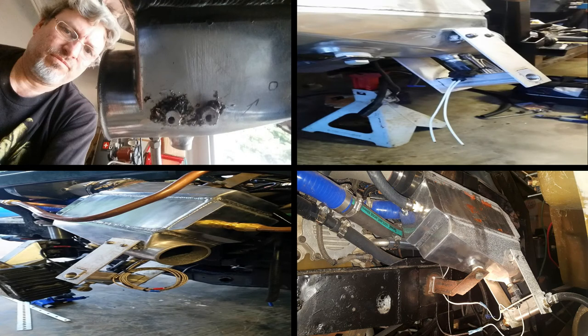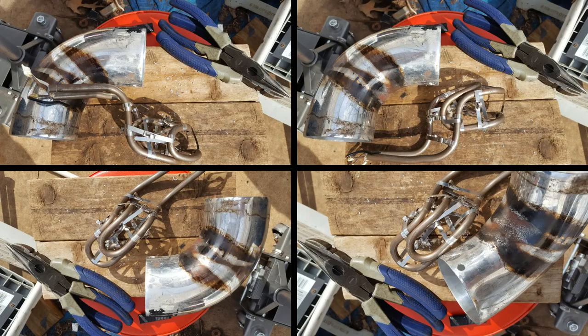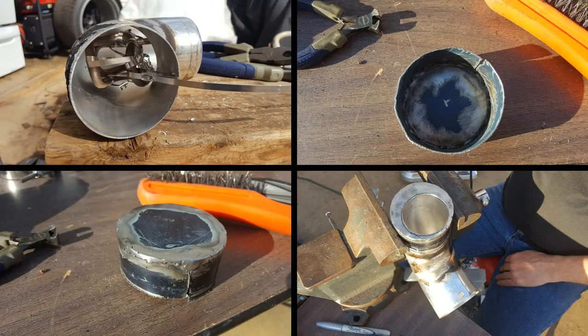The injectors are installed with the rail and the brackets that hold the rail. It does need to be more permanent as this allows it to leak at times depending on the position it gets in. This is a 110-volt charcoal heater that's meant to start charcoal — I've bent it up into the shape so it fits inside the elbow. I use stainless steel tie wraps to make more surface area as a heated grid. It's the preheater that allows me to cold start. Here's where I had to form a cap over the different size inlet pipes.